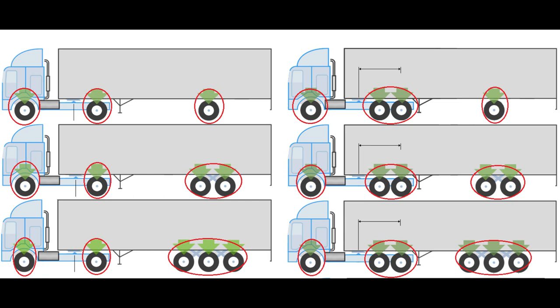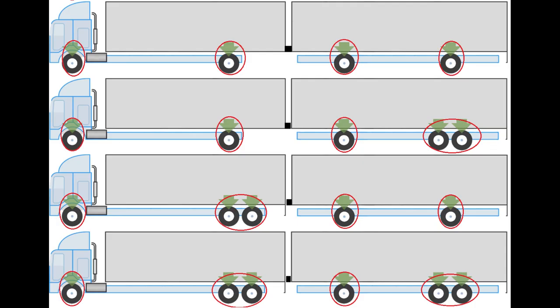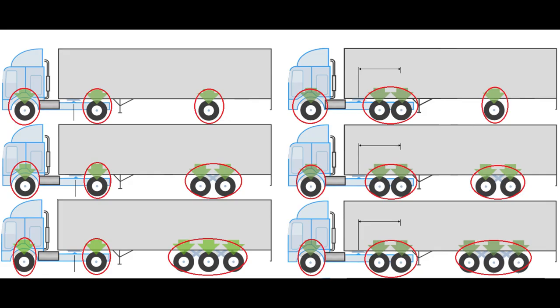Examples show three conditional axes, two conditional axes, and four conditional axes. After that, it is necessary to determine the minimum number of sensors to be installed, taking into account that on each conditional axis there must be installed at least one sensor. The exception is the tractor plus semi-trailer configuration where no sensor is installed on the front axle.